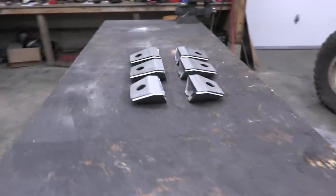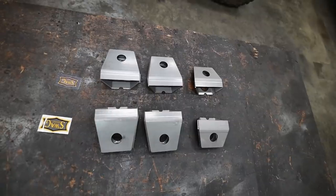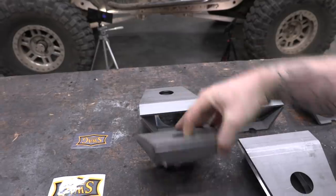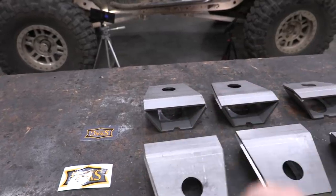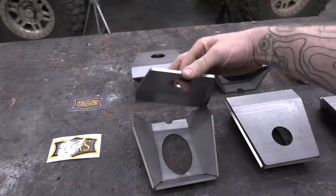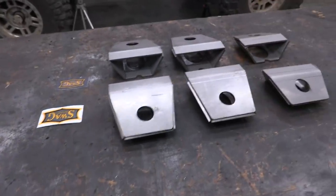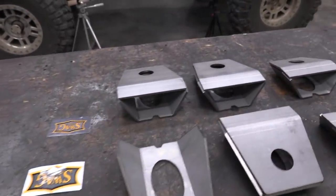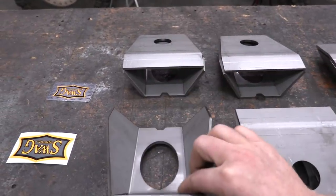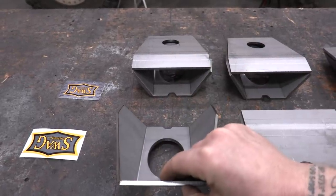Our solution is from Swag Off-Road. They make this really nice upgraded body mount kit, and I love it for a couple of reasons. This tapered design is going to allow it to slide over obstacles much easier. Its box design is going to make it super strong and durable. Not to mention the fact that it's made out of 3/16ths instead of that factory eighth-inch. I also like to see when engineers R&D little weep holes like this — it's so important to have a spot where dirt and debris can flow out of a bracket.